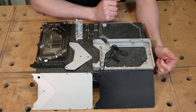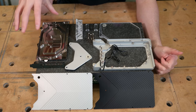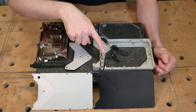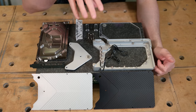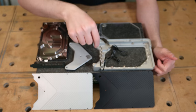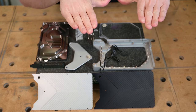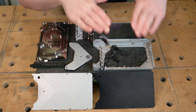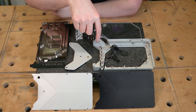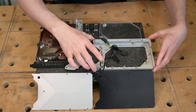And that has me quite worried, because sure, it might have limped through the testing, but quite honestly, that just didn't seem good enough to me. And I have the impression that it's because they were all sequentially torqued up. And then the problem is when you do it like that, it actually pushes the plastic or whatever you're pushing together into the O-ring, which actually creates a gap. Now, the issue there is that you end up with uneven pressure around and you actually can end up with leaks just because things aren't evenly pressed together.